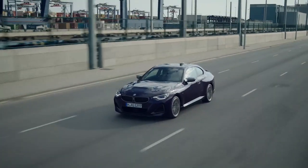The familiar family of B-series engines power the 2 Series Coupe. There's the 220D diesel, which we definitely won't see in our market. There's the 220i with 184 horsepower. Soon to be launched would be the 230i with 245 horsepower and 400 Nm of torque. This is a very different engine tune because the B48 30i engine in the 5 Series gets 252 horsepower and 350 Nm, while in the 6 Series, 7 Series, and 3 Series it gets 258 horsepower and 400 Nm. Here in the 2 Series Coupe, the horsepower is dialed down to 245 but the torque remains at 400 Nm.